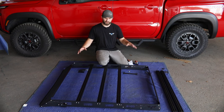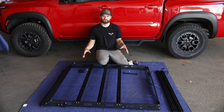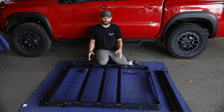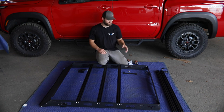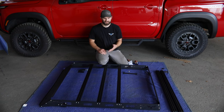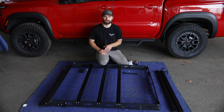As you may have noticed, we already have this rack partially assembled. For the most in-depth look at how to get assembled to this point, you'll want to refer to the installation document on the product page where you would have purchased your rack. The rack will assemble using primarily quarter-20 button head hardware with washers, as well as serrated flange nuts on the inside of the mounts and the front and rear fairings. On the crossbars, those are just going to be a pre-threaded part, so the bolts should thread right in.